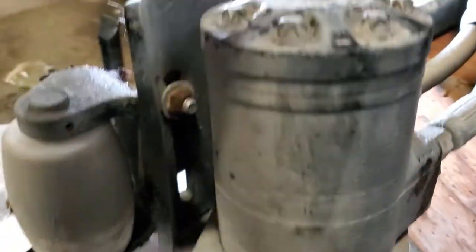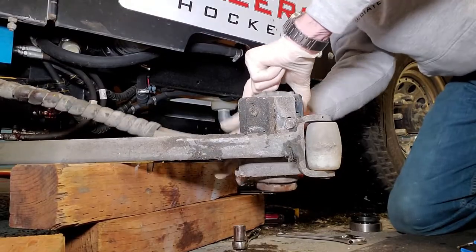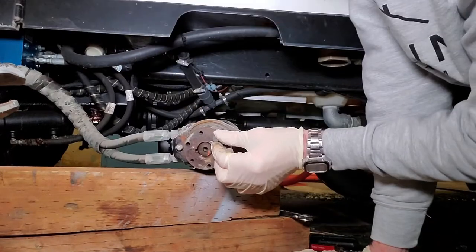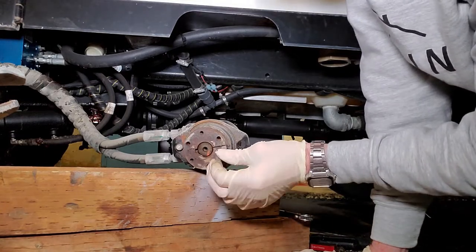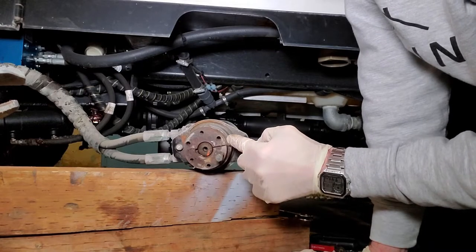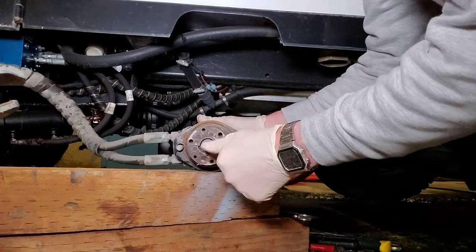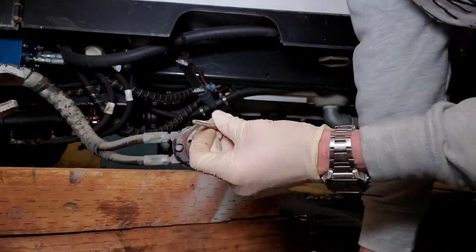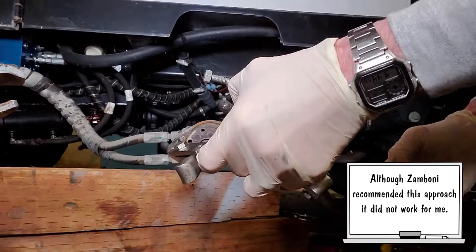So I'm just going to take these two bolts off — there's a nut and a bolt right here. Get this motor off. I'm going to use an 18mm on the bolt there, or 11/16ths would work just fine. Got the motor off. That way I could flip it upside down and get a better look at this. Now when you take these things off and unscrew the plate from this collar, you're supposed to screw the three bolts back into here, and as you screw them in they're going to push against the back collar and separate the two pieces. But there's so much corrosion I can't really get the bolts in there — I think they're going to snap right off. Don said to get a tap and clean it out in there. I'm going to give that a shot before I get the bearing puller out.